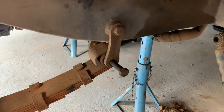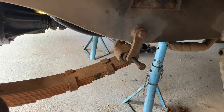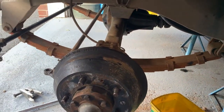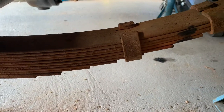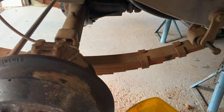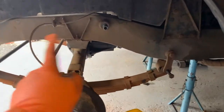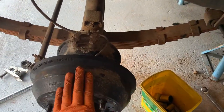It's lovely and rust-free and the chassis is lovely and sound. Just after I filmed that last segment I phoned Paddocks and cancelled the order for the springs - they're actually in pretty good condition, only surface rust really, and it seems a bit overkill to fork out probably 160 pounds on two new springs when it's the bushes that are letting them down. So I'm going to take the springs off, wire brush them thoroughly, paint them up and let plenty of oil soak in between the leaves, and also replace the bushes either end on both sides. More work, yes, but saving money to invest in rebuilding the swivels.